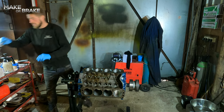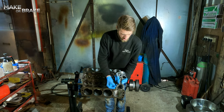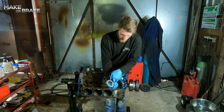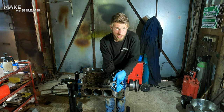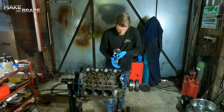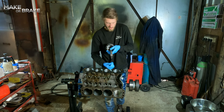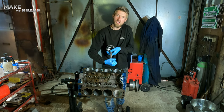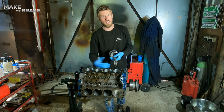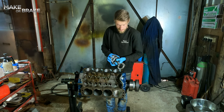The reason I'm going to put 2 in now is because, like I said earlier, the bottoms of our con rods are handed, essentially, because they've got a small chamfer one side and a big chamfer the other, and the chamfered side needs to face away from the other rod. So face the crankshaft on the chamfered side, face the other rod on the almost non-chamfered side. I think it's to do with oil, being able to get oil feed and oil drain, but I'm not really sure. It's just the way that they have to be.